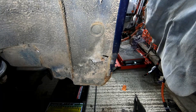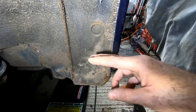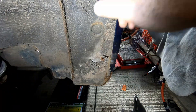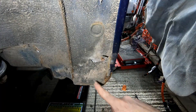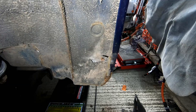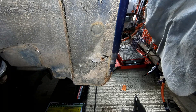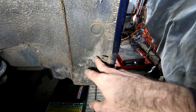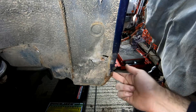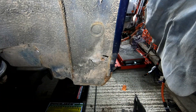This is why I've got a problem with the rear sills on my car. Basically the wheels have been throwing muck up over the arch liner I just pulled off and depositing it in here. This is a solid piece — looks like sand. I reckon this thing might have been driven on a beach or near the sea. It's really disgusting. It also means a lot of moisture has been held against this part of the car, which is why these panels are going. So we're going to have to cut it out again and refill it.